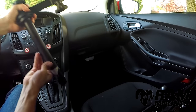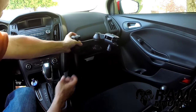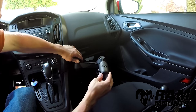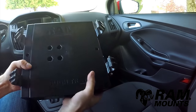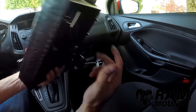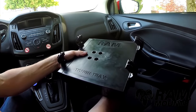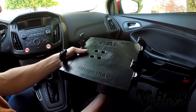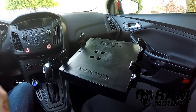You now have a stable mounting platform inside the vehicle. Take your upper telescoping pole — assembled earlier with the swing arms — and drop it into the lower pole. Position the direction of the swing arms coming off the pole, then tighten the knob in place to secure. Take the RAM Tough Tray assembled earlier, and drop the ball component underneath it into the open socket at the end of the swing arms. Tighten the knob to secure all components — you now have a complete rugged laptop mounting system.